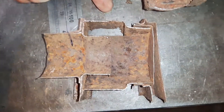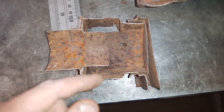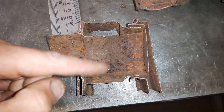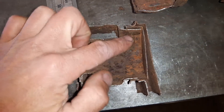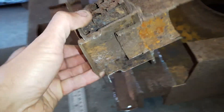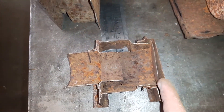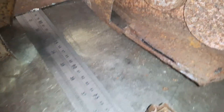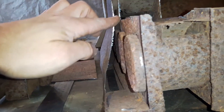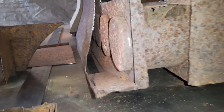The air is coming in through this rectangular aperture, swirling around the back face — and you can just see the start of the cutout of the slot there. Removing the next section, you can indeed see the slot. The air swirls around, is extracted through this slot, and then falls down into this hollow cavity on each side. As you can see there's an extract slot in the bottom of the air filter. The air then continues drawn through the middle portion into the main chamber.